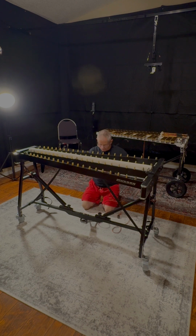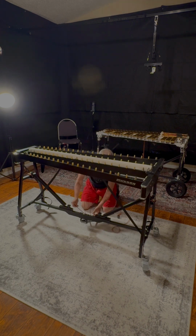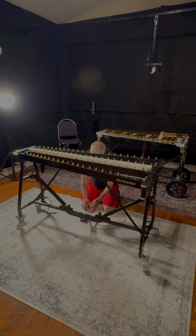And so I like to go through this side, and then you go back up through the eyelet that you normally would attach your pedal rod to, and then you come back here again. Actually, you don't have to do it twice. I like to do mine twice because it just gives me a little bit. If you remember from science class, if you do it twice, the distance that your lever will travel is half as much when you pull the string, because you're using mechanical advantage. You don't have to do that, but if you decide that you want to, you can get another string and do it. I'm going to cut this to the right size, because I think in your situation, it's not actually going to be beneficial to you.